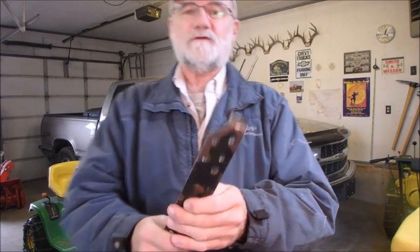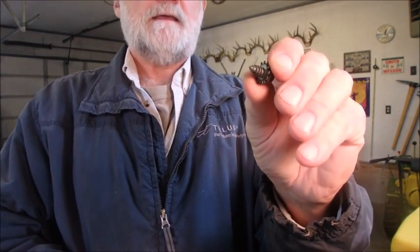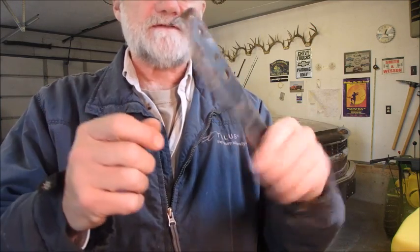I have drilled quarter-inch holes where the spot welds were, and I'm going to remount it to the bottom of the new seat with these self-tapping screws — lag bolts, I guess. It should work really well; there's just enough to bite the sheet metal, though it's thinner than the other seat. We're saving 200-and-some dollars, right? So now I'm going to put some black spray paint on this, holding it 12 to 18 inches away. I'll bring it back when I'm done painting.